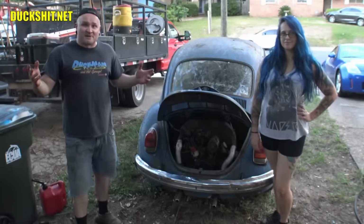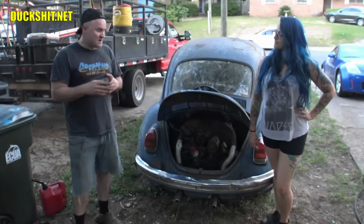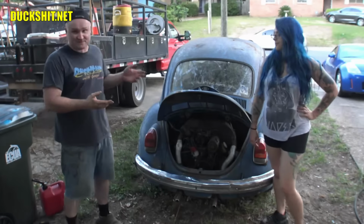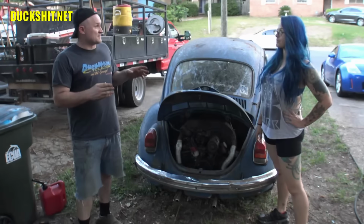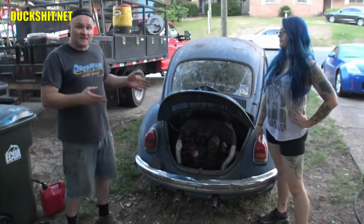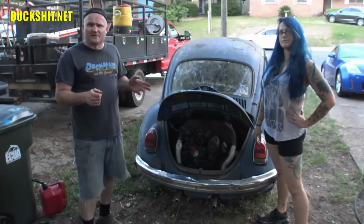All right, well, thank you everybody for watching. We're gonna stick a pin in it at the second because you guys saw it crank, we saw it run. We're having a small problem with fuel delivery, or maybe it's just the fact that there's still some old fuel in the line and in the carburetor. Wouldn't be the least bit surprised if the carburetor has some junk in the jet. But nonetheless, we got it to fire up. We got the thing to run, but it is having problems cranking over, so the solenoid appears to be sticking.